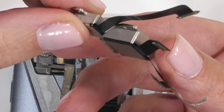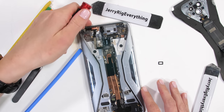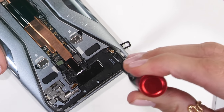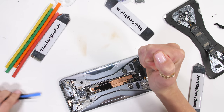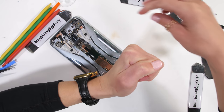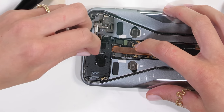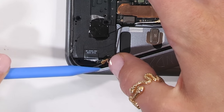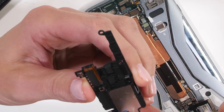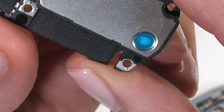Let's see what else is interesting about this phone. The top loudspeaker comes out next. You might be thinking to yourself — hey, why don't we see any batteries yet? And that's a good question. I have no idea. There is a piece of black plastic down here that needs to come out. One cool trick is if you hold the screwdriver still and just rotate the entire phone the correct direction, the screws come out eventually. There's a bit of black tape and a small connector clamping onto the black bits, and then the bottom loudspeaker can come away from the phone. It also has little balls inside, like we saw in the Galaxy S20 Ultra — they look like spider eggs, which is kind of gross.